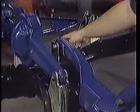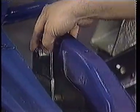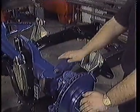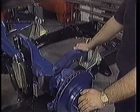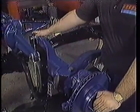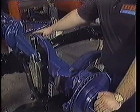Come over here, and basically the same problem exists here, and you'll notice this bracket is piggybacked into the stock bracket. Then we come here and you'll notice that this particular system retains the stock radius arm, which is giving us the same stock geometry, the same stock triangulation on the bushing here, which can lead to a binding condition.